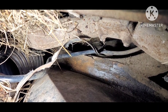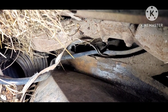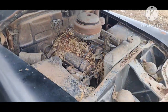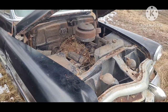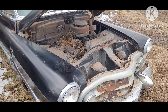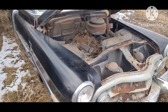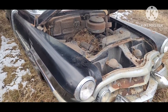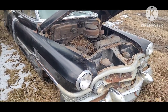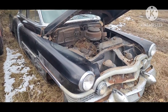This one has good crisp stamping, unmolested. This was an Iowa car, and so there's always a chance on some of these that come from real salty places that you might have some corrosion and pits. You do want to be real careful once you have that thing found that you're using pretty gentle means of cleaning it. You don't want to add scratches that obscure and change those numbers.